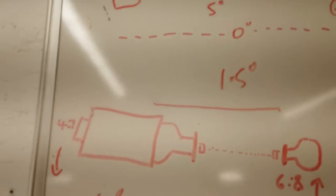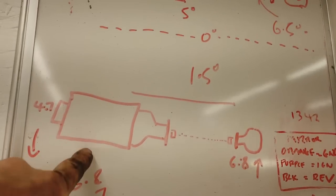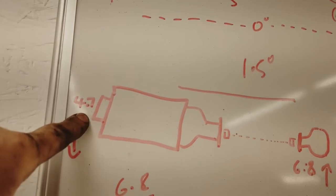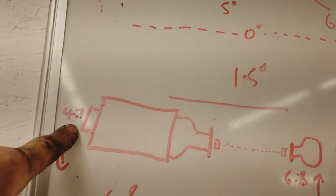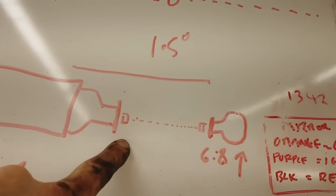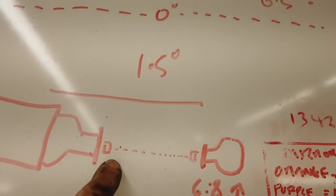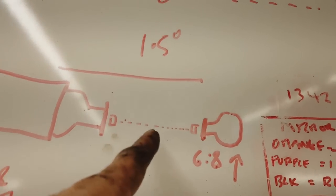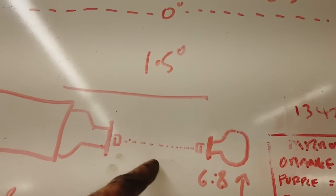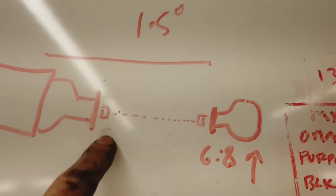Here's the board. We have the engine and gearbox here. You can take the reading of the inclination of the engine on the pulley at the front if you want, or you can take it off the output shaft of the automatic gearbox or your manual gearbox if you take out the drive shaft, prop shaft. Bear in mind, when you do that, oil will try and escape. I have a blanking piece which I insert. You have to quickly pull the prop out, oil starts to come out, quickly shove the blanking piece in, which is basically a cut down prop, just stops oil pouring out.